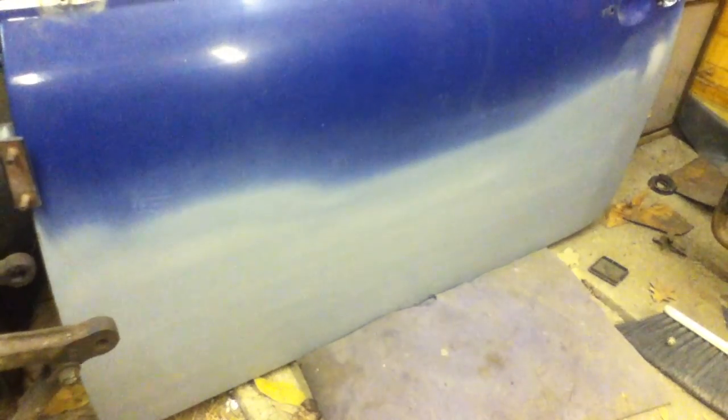This is the near side passenger door. Had a repair panel along the bottom there, filled and painted, and I've done a pretty good job. I'm pleased with that. And then driver's door - driver's door as well needs filling, but it's all done. Just sort of repair panel on the bottom there, and also the inner panel as well. That's been done as you can see along there - I've made quite a neat job of that. It shouldn't rust again. Obviously you've got to fill the bottom there with wax oil so it really doesn't rust again.